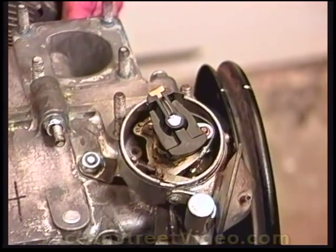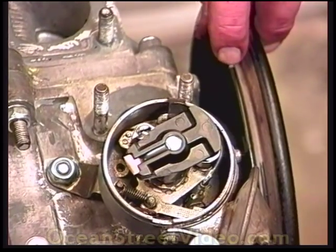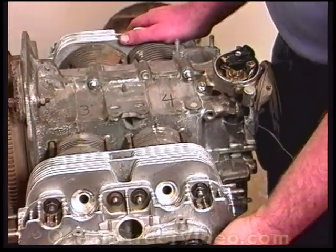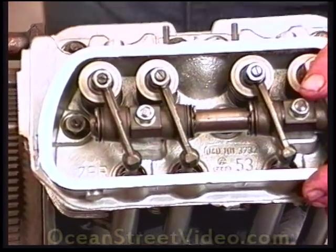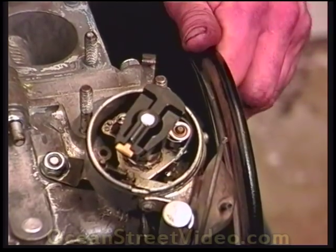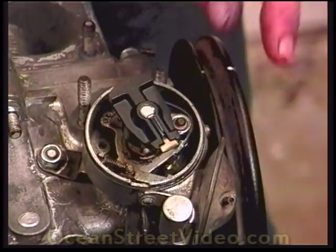Now we'll bring it all the way to number three. We're at bottom dead center now. We're going to bring it all the way around again. Now we're back up at top dead center — we're now firing number three at exactly 180 degrees out, and the procedure for this will be the same as we did for number one. Now we're going to move it to the bottom dead center for number four. You can see your distributor rotor turning around — that mark we put in here indicates we're now at number four. You can see the number four rotor pointing in this direction right here.